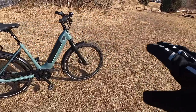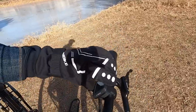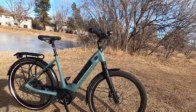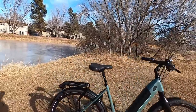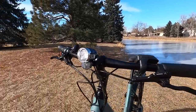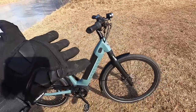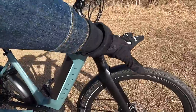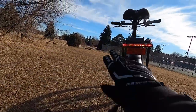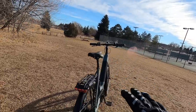You get fenders front and rear, and lights in the front and rear. I love the lights on these things — the Axis Blue Line, 50 lux. Super bright. They've got side cutouts so it shines to the side for good side visibility, plus sidewall striping on the tires for extra visibility from the side. The rear light is also very visible from the side with four LEDs. The front light is adjustable for angle, mounted high and center so it turns when you steer — making it a lot easier to see where you're going around corners at night. The lights are on by default when you power on the bike, but you can turn them off if you want by holding down the plus button.